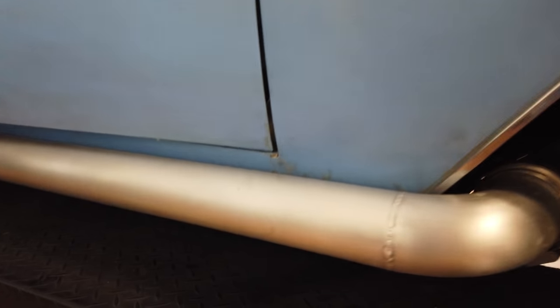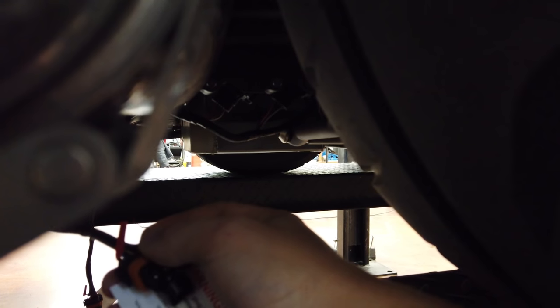Mostly just flat to help break the wind above and below. So I'm going to go ahead and program the NTK sensors into the Holley right now. As you guys can see, we have them hanging in the car. Right here on the plug to the O2 sensor it says — hopefully you guys can see that — do not plug the sensors in until you have it configured for this sensor. I'm not sure if you plug them in while it's configured for Bosch if it will hurt the sensor. So I'm not going to risk anything. I'm going to go ahead and open it up, swap them to two NTK sensors, and then write that program. Then we will plug the new sensors in and try them out. Hopefully we are good to go.